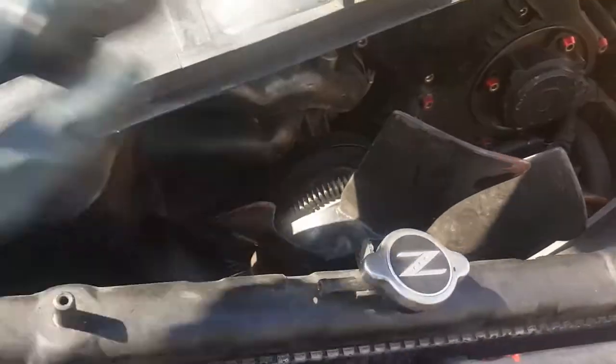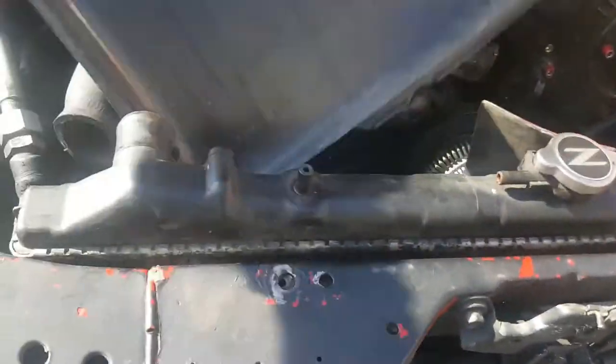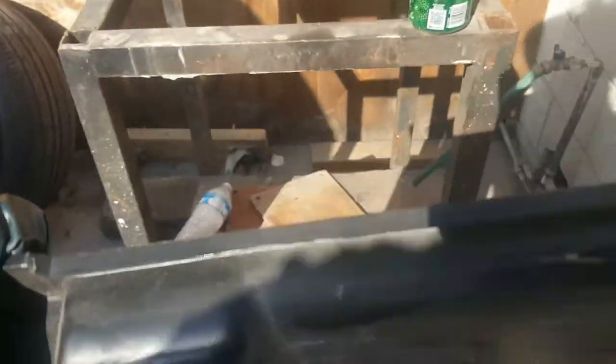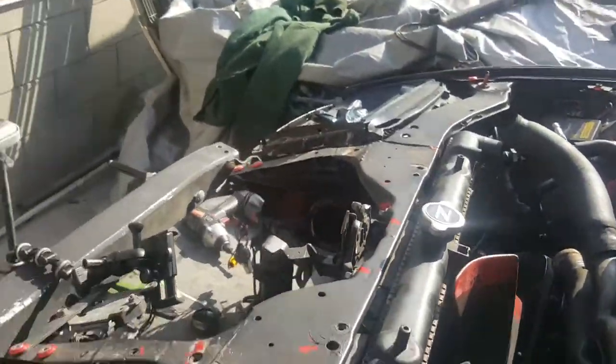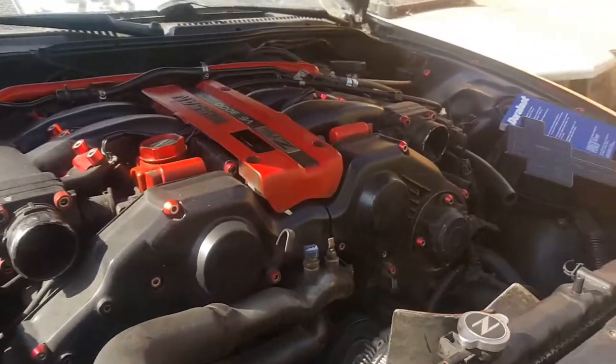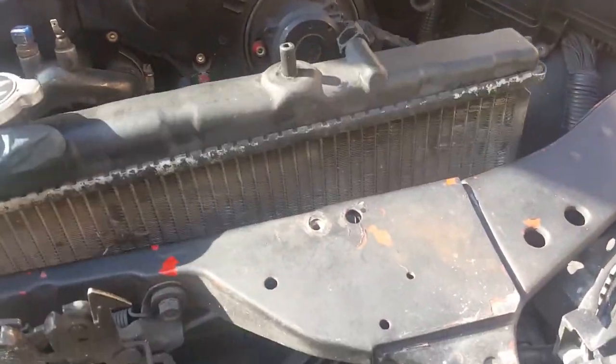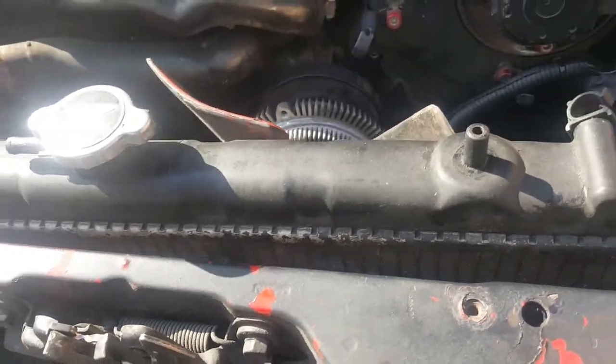The fan shroud is usually mounted with a small clip that goes between it and your radiator — and voila, it's off. Before you pull up the radiator, you also have to remove the hose at the bottom. I already removed it, but just to show you — that carries a hose with an 8mm clamp, or your OEM clamps. Honestly those aftermarket clamps are just as good; I've been using them for years. Now lift the radiator out.